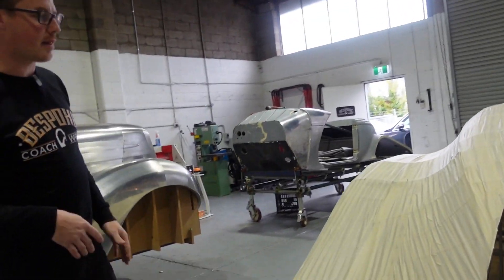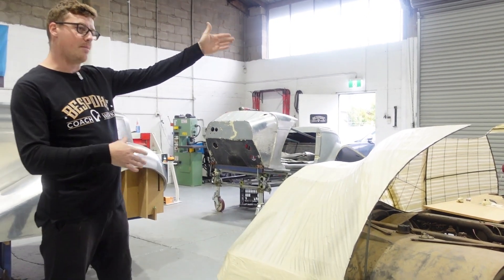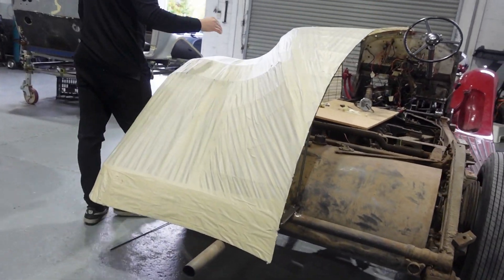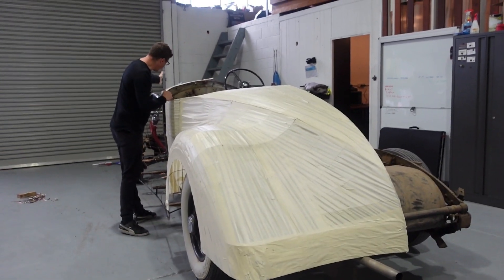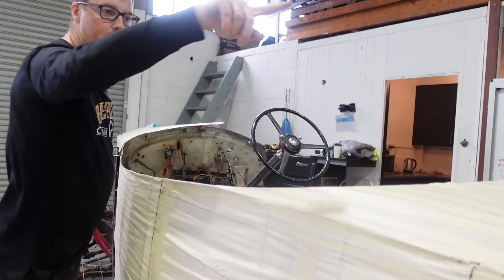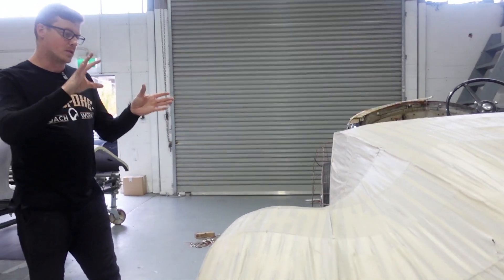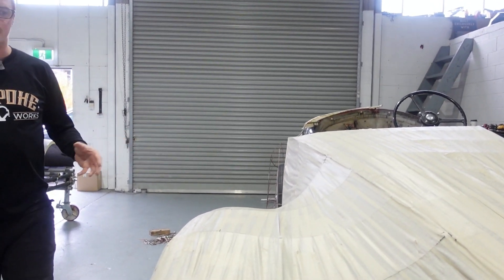Coming to the back of the car — we started with the back. I left the front half on the car in my initial design stage, and the reason was you could see that the bonnet was projecting a line and then it sort of really kicked away on the original body. So what I had done is I ran this first piece of wire — this big main arc — and I projected through the bonnet edge through into the door edge. Essentially what I'm trying to do is project a line from the front of the car that wraps all the way around to the tip of the boat tail. So with that, I ran my first couple of stringer lines to create a silhouette of what I wanted for the car. I ran across the top line and a bottom edge just to give me some bases to start with.